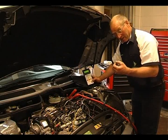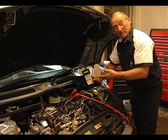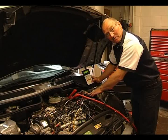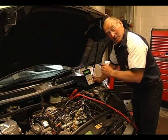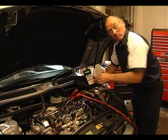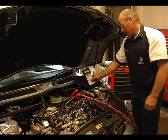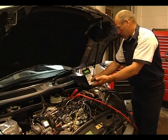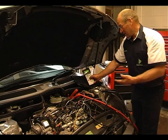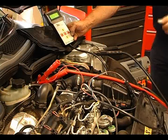At the same time, what's taking place is the volume valve is observing this. This system is still in a form of closed loop control. I'm playing about with this valve independent of the ECU. The ECU is seeing that the rail pressure is not within its anticipated map, so it's driving the volume valve trying to fight me. As I drop pressure, it will increase the volume to build up and restore the pressure. And if I increase pressure - there you see the rise to 400 bar - the volume control valve then immediately tries to counteract me.